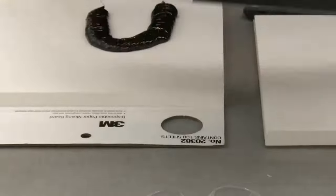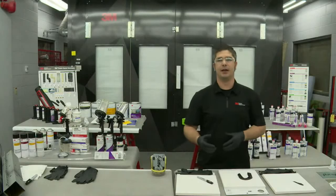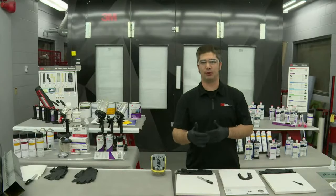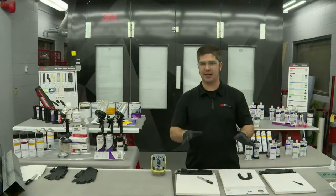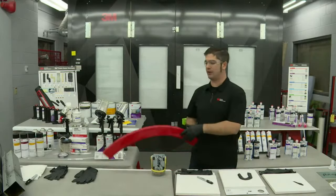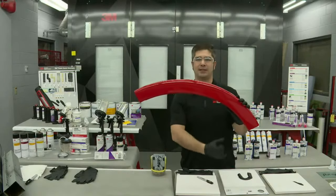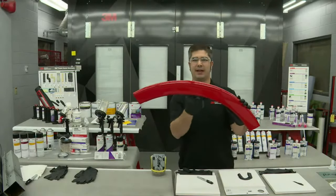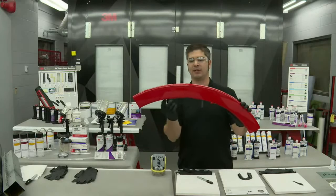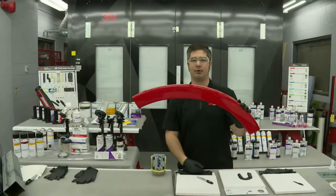So a fun fact here, most paint companies have tech data sheets for the products and what needs to be applied and how many coats, what size atomizing head and so forth. That is so that they can prevent corrosion and make sure that that final application does not leave the vehicle in danger of having corrosion. One of these areas where this is very important and is also a good representation of this is like a wheel arch. Okay. A lot of vehicles have that seam sealer on that wheel arch, and it's not necessarily to protect that hemmed over flange or that pinch weld and so forth, but it's actually to help aid against rock chipping and stone chipping along that edge where the wheel is really throwing a lot of that road debris and everything else up there.